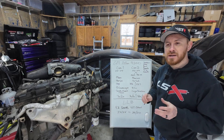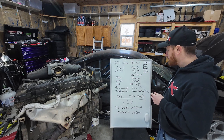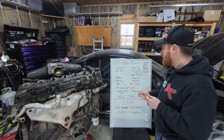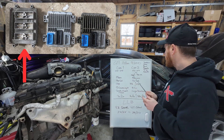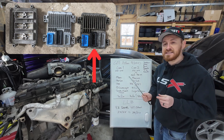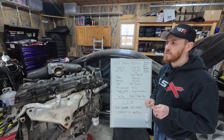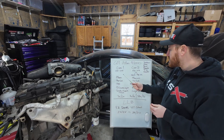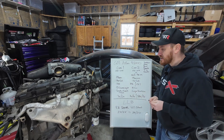There is a difference in the ECUs and how this motor is run. In Gen 2 there's actually a mid-gen change: from 2008 to 2009 it uses a completely different computer and a different way to pick up cam and crank signal. Gen 1 uses a P10 computer; 2006–2007 uses a P12; and 2008–2009 uses an E67, which is actually used on some LS applications — I believe the GTO and later, but don't quote me on that.